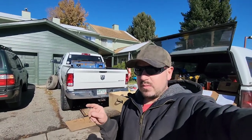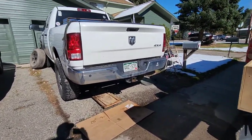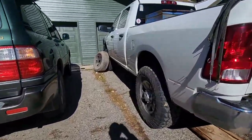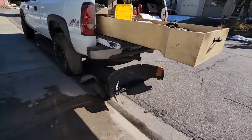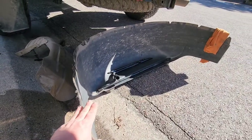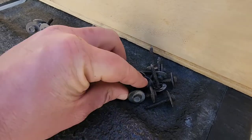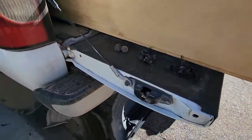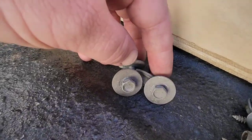That's your main hole, plus four smaller holes for your safety chain loops. To prep for the install, you'll want to remove the spare tire — that gives you a lot more room to work underneath. I also recommend removing the fender liners if your truck has them; they're held on with 11 eight-millimeter bolts on each side. Also remove the big heat shield between the exhaust and spare tire — that's four ten-millimeter bolts.